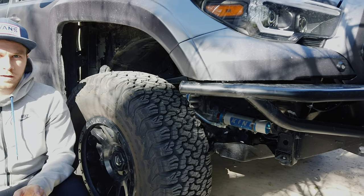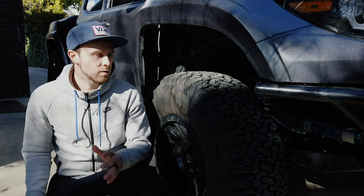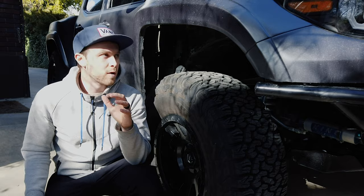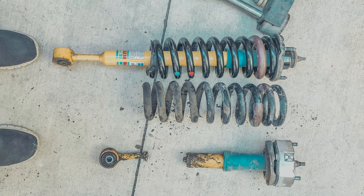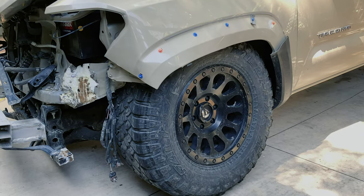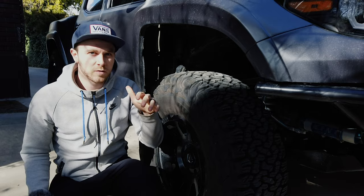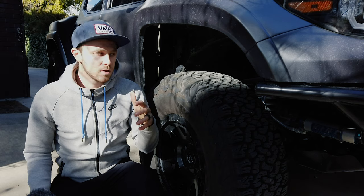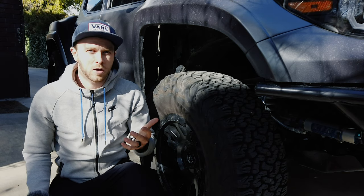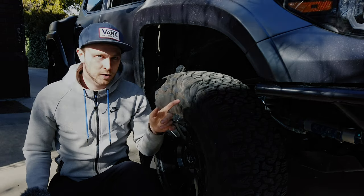During the crash, the front suspension was completely compressed and broke in half, so the tires were actually pushed up against the fender well. That tore apart some of the structure in the fender — it pulled some pinch welds apart — and I needed to fix that, otherwise water would get in and cause problems in the future. So I came up with a plan and we'll jump into the garage.